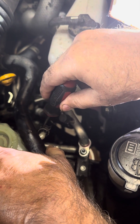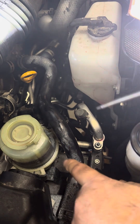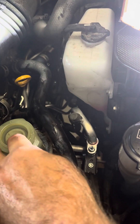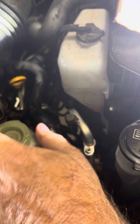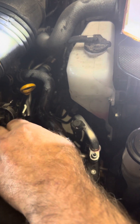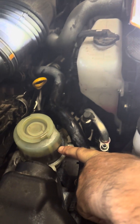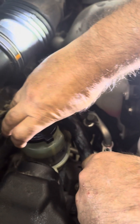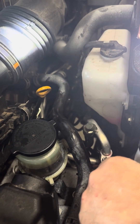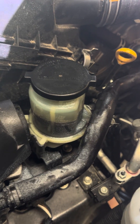It was just a matter of putting the hose back on, putting the clamp back on, and making sure that my reservoir was filled to the max capacity. I did go ahead and start the engine at that point, then go full left and full right locks, back and forth, just to see if it pulled any more fluid and to make sure everything was working as expected. Very smooth operation — you'll probably see a difference putting fresh fluid in there, especially if yours is degraded over the years. There you can see my max fill line. This job is complete. I'm going to put my cap back on. Thanks for watching. This is a 2019 fifth generation Toyota 4Runner.